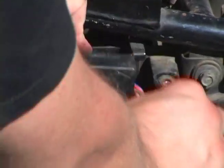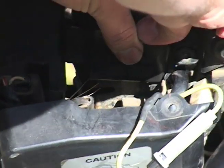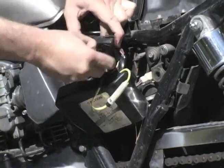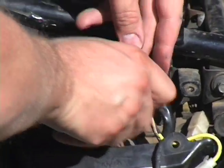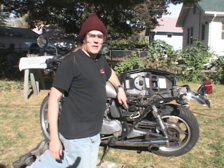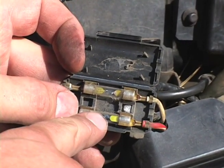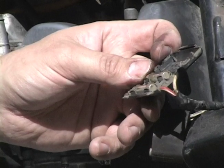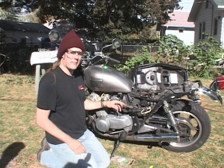Now you might discover that you made a mistake by doing that — you might someday lose some of your electrical functions. I should actually show you: this blue fuse that might be going bad is the headlight. Often the headlight goes with the taillight, so if you've got a problem where your head and taillight weren't working suddenly, you should look here first, because that fuse was the wrong size — it's a little more liable to fail than the rest of them. Good fuse, bad fuse — the bad fuse came apart in the middle; it burned up. That means something on this line took too much current.